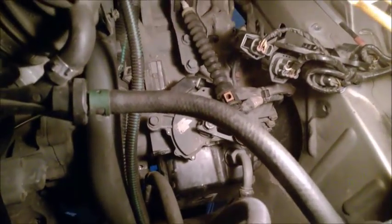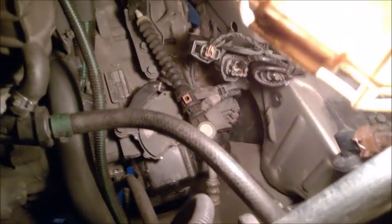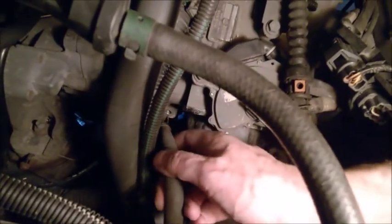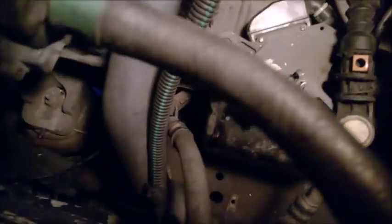Also, I forgot to say, but try to clean everything before, around the cover, around that hose. Really, when you disconnect these two lines, clean everything, and when you put them back in place, the smallest amount of dirt is going to leak. So that return hose, again, it's here. Just toss it on the side. You just jiggle it a little bit and you find a place for it. And it's really clearing the side of the cover.